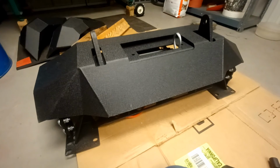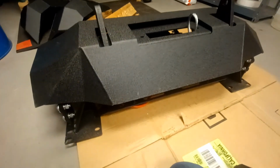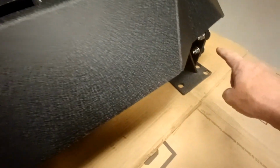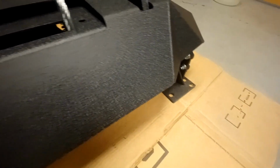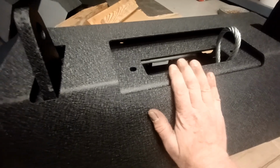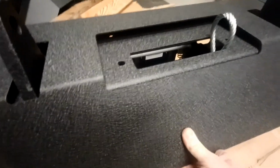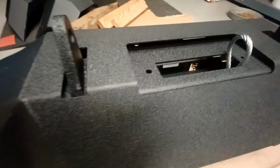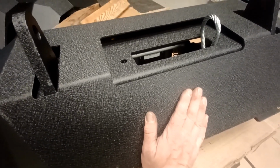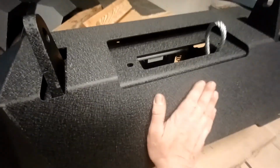So I did a dry fit of the center bumper piece to the winch plate, which you can see here. It involved this bracket and this bracket. I put them flush with the winch plate, set this bumper on, checked for any loose jiggles from side to side, and checked my gaps around. Then I cranked down these brackets. I'll remove this outer bumper, hook the winch plate to the car, then attach this bumper to that.